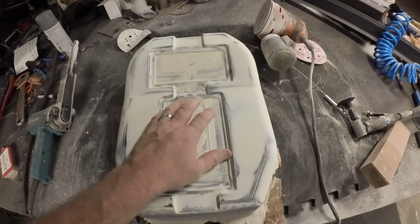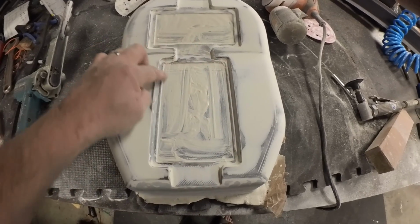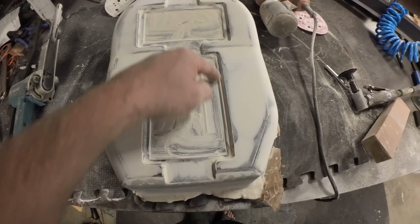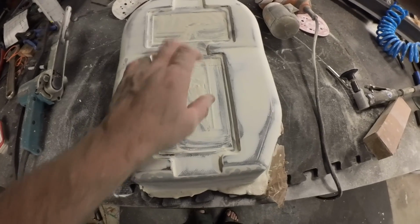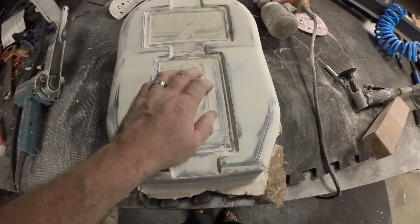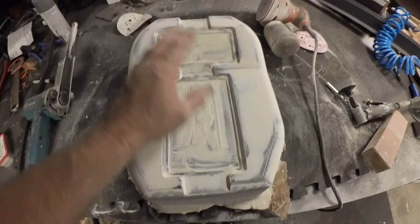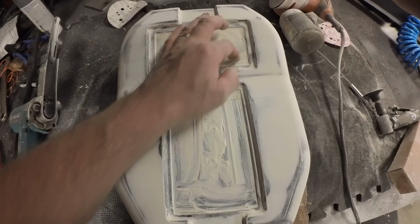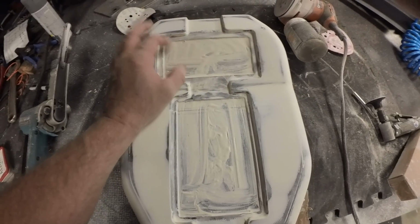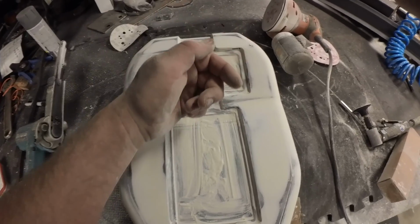So this right here is a screen for your map, and this will be basically just like your normal app, like Google Maps or whatever you want to put in there. Touchscreen. Probably not completely IP67, but probably pretty rain resistant. This will be a Raspberry Pi screen, probably with a polycarbonate mask over the front, and this is going to be our digital dash. It's going to run on CAN bus, which is output from the Kelly controller.